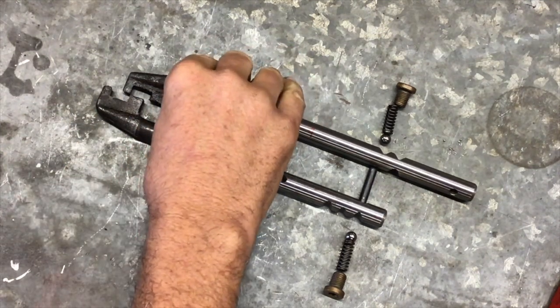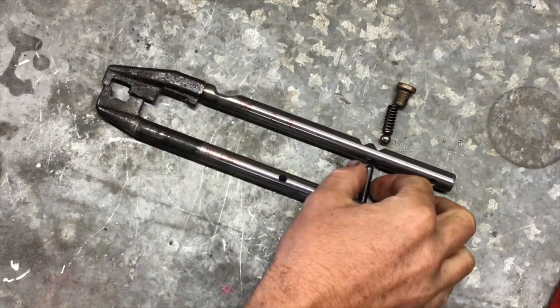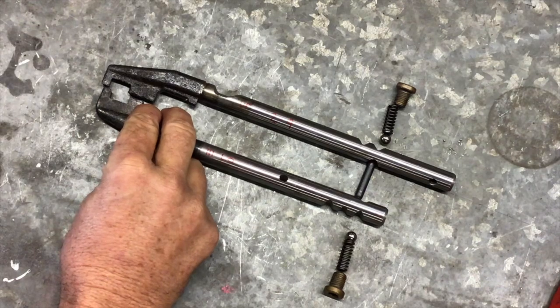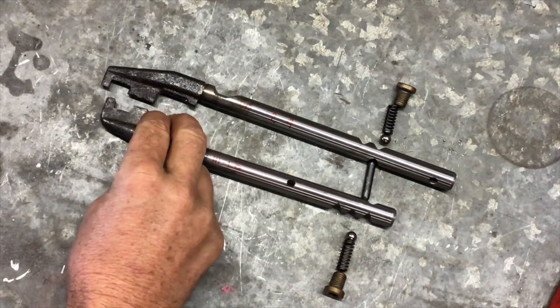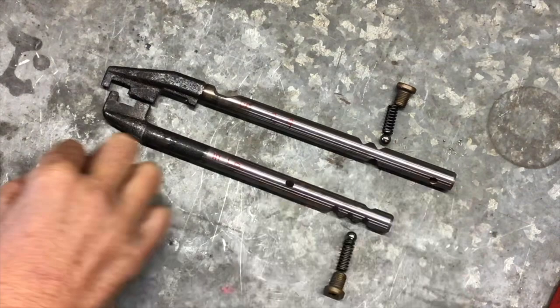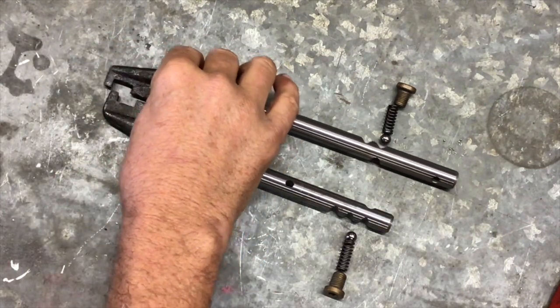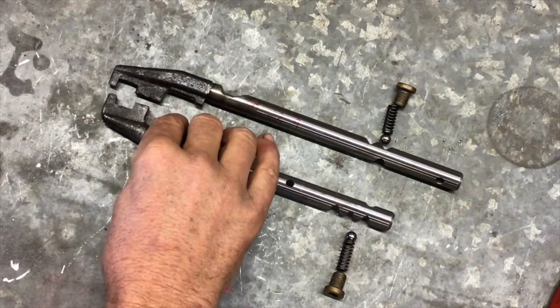So when you do that, this one moves that way, that pin can slide across, and then you can select — so that's high, neutral, low. But once you've deleted that pin, you can move the two rails independently: 2 and 4, high, neutral, low.